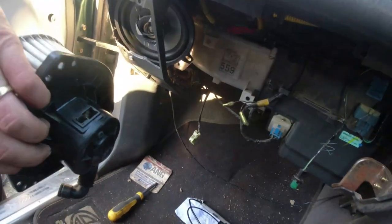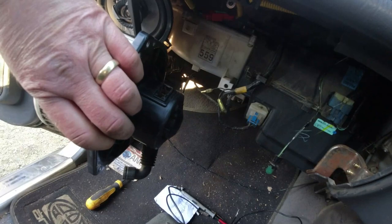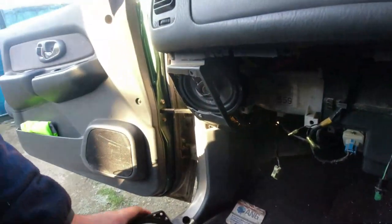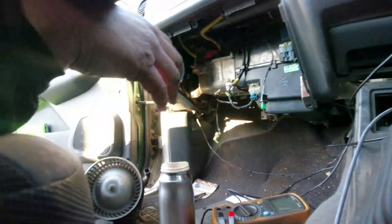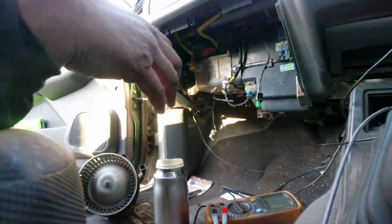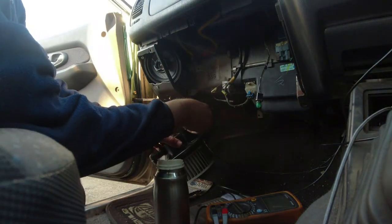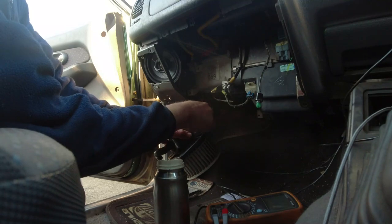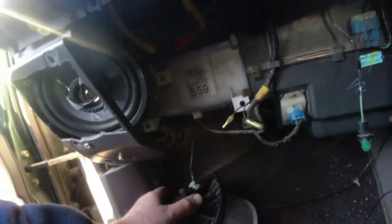Could I get it working? So then I took the motor out and I bench tested it across a battery — worked beautifully, no problems at all. When I connect up the blower motor — ignition is on at the moment but the switch is off — connect up the blower motor, operate the switch. The switch is on slow at the moment and then the fan starts working.